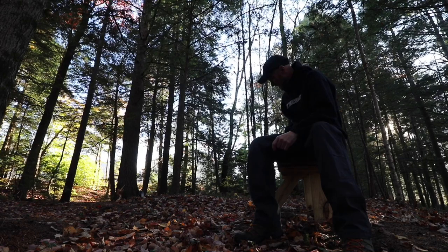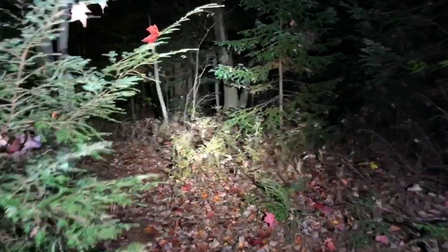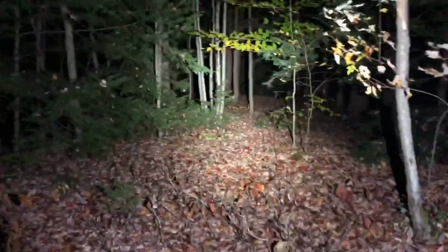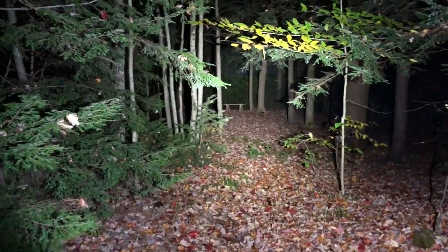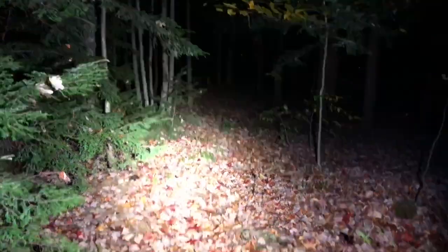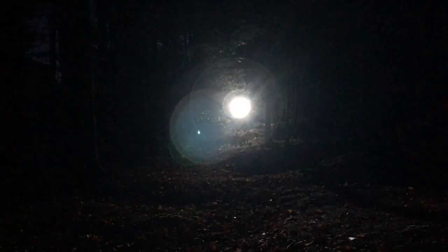Obviously you want to see some nighttime footage, so that's what we're going to roll. As I tell you about the settings: turbo is 2,526 lumens, and that goes down to 610 lumens after 150 seconds, then it will sit at 610 for 237 minutes. Your strobe is at 1,294 lumens and will run for 320 minutes. Your infinity — the press and hold cycling from high to low — has a lowest of 31 lumens.